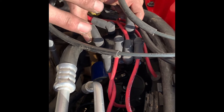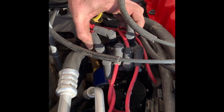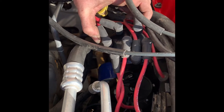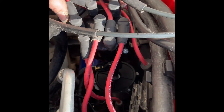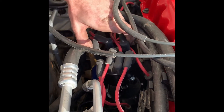The new distributor comes pre-pinned from the factory so the rotor won't spin differently from the distributor itself until it gets put in. You can tell if it's put in correctly if the bolt lines up with the little notch on the side. There is a little keeper that has to go back on even though the distributor has a notch where the bolt goes down — there is a keeper around the outside edge of the distributor that has to go back in.